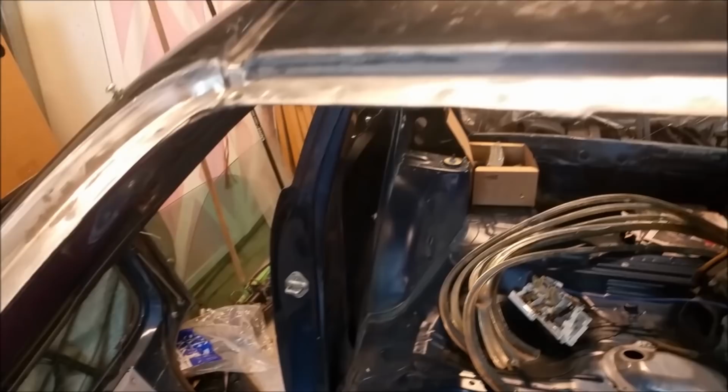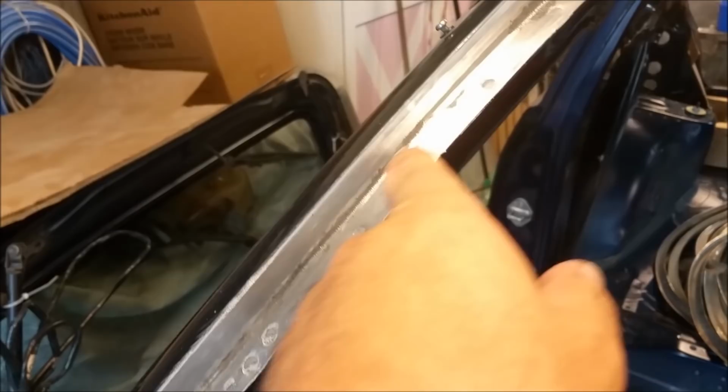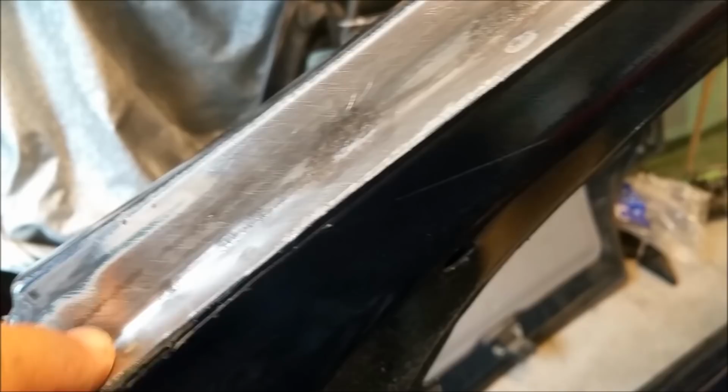Now, what's happened, obviously having a couple of screens, I thought this was the original screen, but the car's got 300,000 or 400,000 Ks or something. We've got this sort of thing, surface rust. Now, this was exceedingly difficult to get out, and I imagine it was urethaned in, all down there. It's not bad, but I reckon we got to it in the nick of time. The blades used for cutting them out, I reckon, scored the paint and affected the zinc plating, and that's how moisture's got in. So we've got to be pretty careful about this.